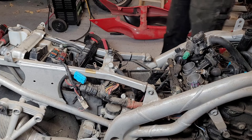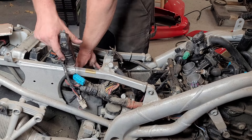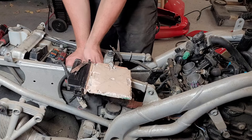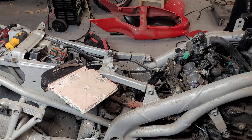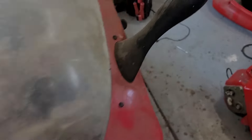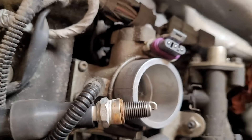Let's temporarily plug this in. Get the battery in first, then we should have enough space to flap the ECU up top. We're obviously missing the ground line at the bolted tube but it'll be okay just to test. Connect the battery up. Good news — check engine light is on! Let's turn it around and see if we've got spark. I'm willing to bet that we do. We do not.